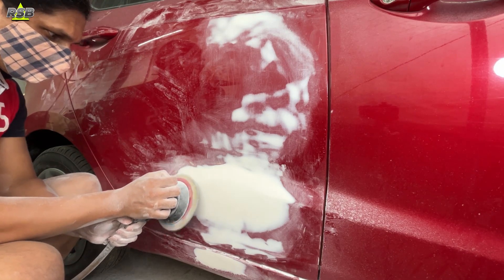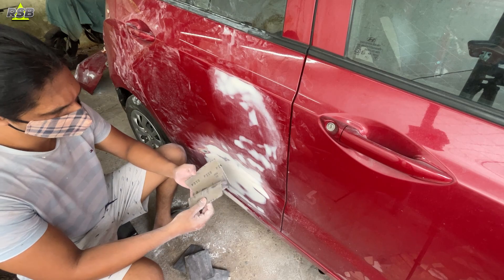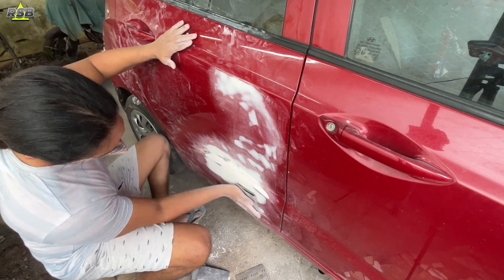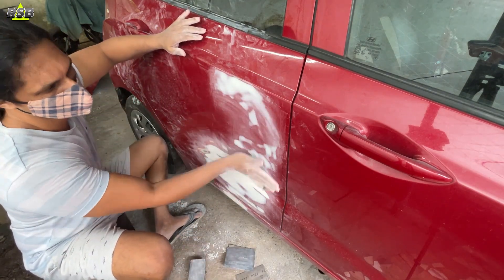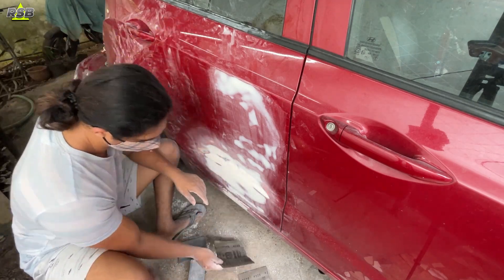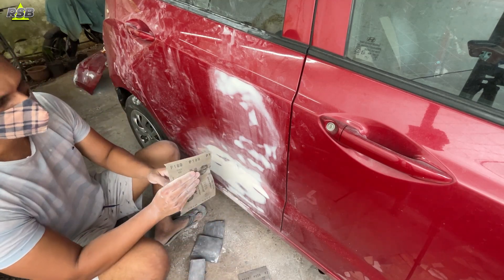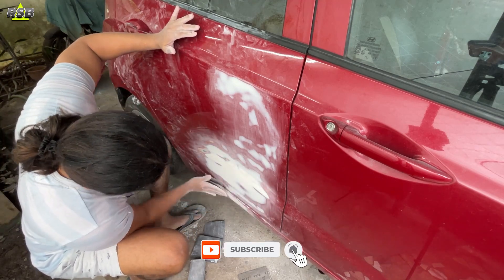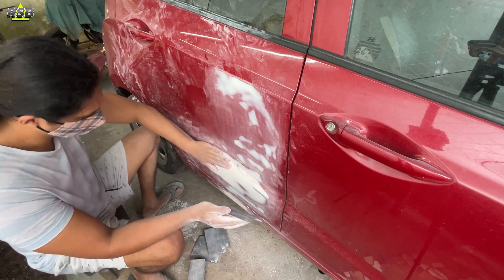The last thing you need to do is take out the deep scratches created by your sandpaper — to do that you will have to use multiple sandpapers of different grits. I have already made a video on that and I will put the link in the i-button above. By working through the grits you take out all the sanding scratches from the coarser grit and your surface is ready for primer. Once leveled, the body filler becomes a very thin layer and the surface paint starts to show through. Use as little body filler as possible — if you leave it too thick it will crack and come out after a few days, ruining the entire paint job.